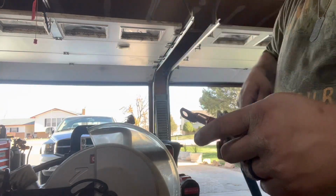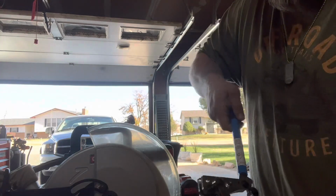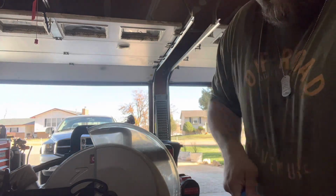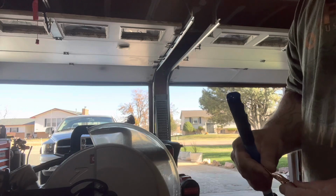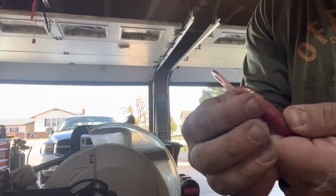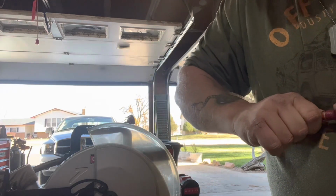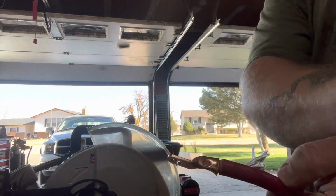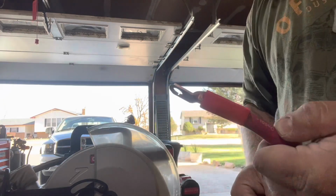And we'll get our crimping tool. Fit this in there. And then crimp that down. See, I put a bunch of little dimples in there, but it compressed that, and that's not going anywhere. So that makes a nice solid connection. And then take a little bit of heat shrink, slip it over, heat that up, and that will hold that on there.